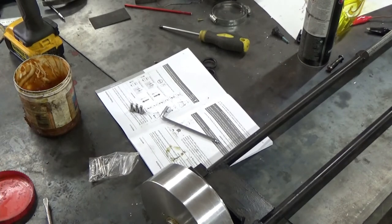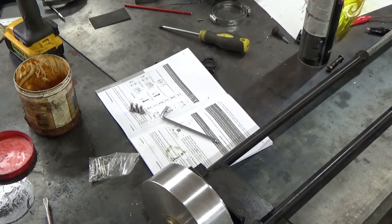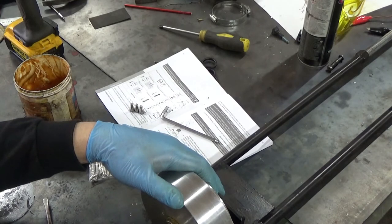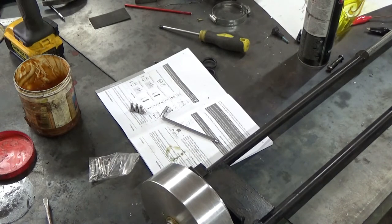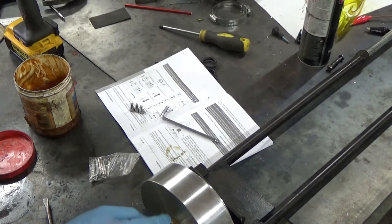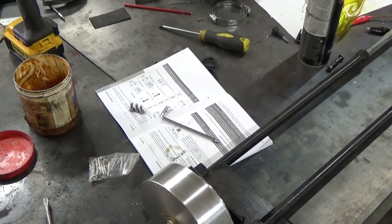In your shaft there's a split pin hole — we might be lined up on one now, and we are. Some shafts have two split pin holes at 90 degrees to one another. Mine isn't at 90 degrees because I made the shaft. I've got it lined up to one and I'm going to back it off to the next, because I've got a castellated nut — that's all I can do. You've brought it up until it's just nipped, literally just touched — you can feel it touch — and then you figure out where your next hole is.